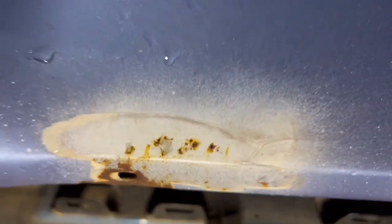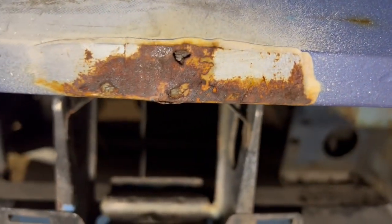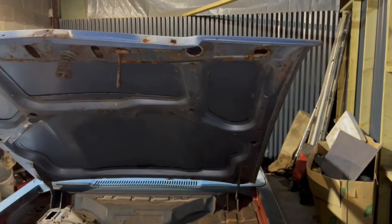There's a repair here which I think I'll just cut out and redo — it could be done quite a bit better to be honest. It's got a decent gap across the bonnet. The bonnet's pretty good in the corners where they always rot, although it has got a few pin holes on the front of the bonnet — same here — but they're nothing to repair, pretty easy. Under the bonnet it ain't too bad either — there's probably just seam sealer. A little bit scabby but it's just surface rust, should clean up pretty good.